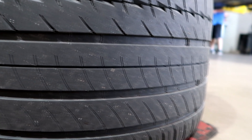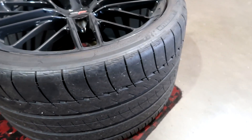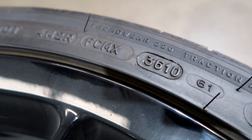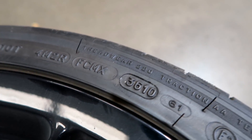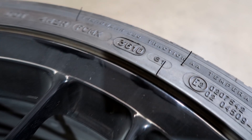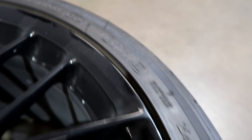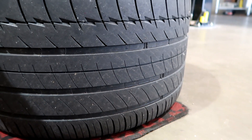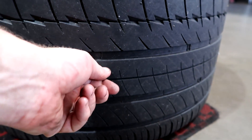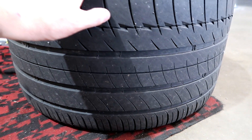This is something we see a lot — this car is a 2011 and it looks in absolutely fantastic shape. Problem is, tires have dates. I think it's five years when you should replace them. If you look for this code right here — see this number 3610 — that is week and year. So that's the 36th week of 2010, which corresponds with when this car was made. It was a 2011 model, so these tires would have been manufactured a few months before the car went on sale. That's a 10-year-old tire in perfect condition, but unfortunately the rubber is no longer pliable — it's almost hard. It'll be dangerous to run at any kind of speed.